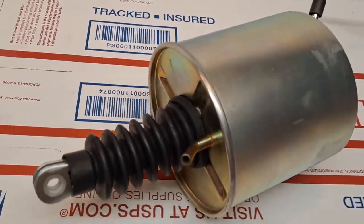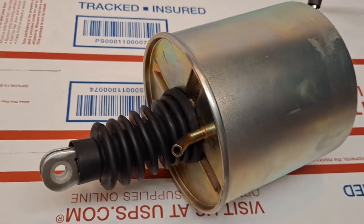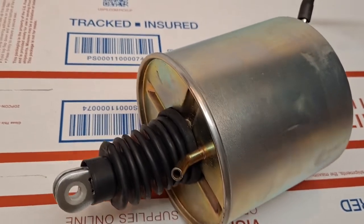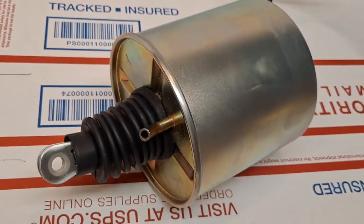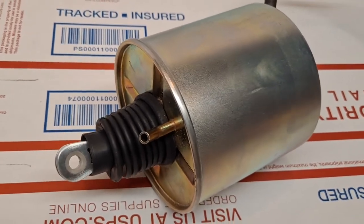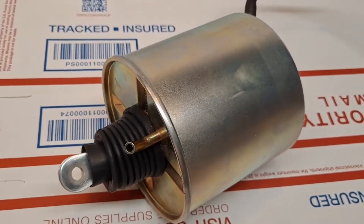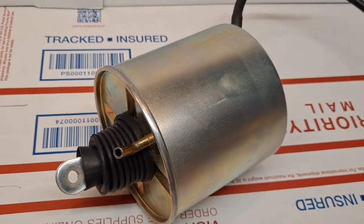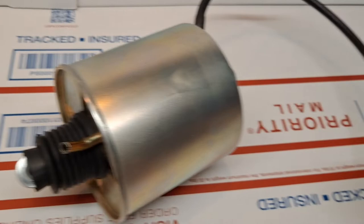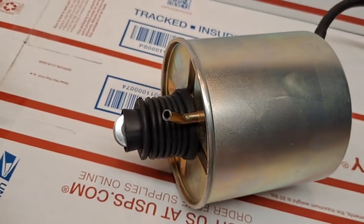We can be looking for the retraction. This will be much faster using the vacuum created by the intake manifold of the original 472 or 429 engine, depending on whether it's a 67 or 68. We see that when we have full retraction, we also have full closure of the headlamp door. And there we are, holding vacuum integrity at 6 pounds.